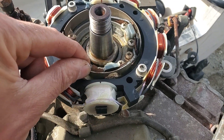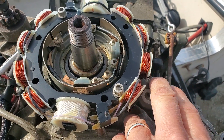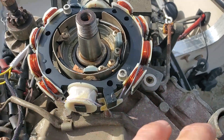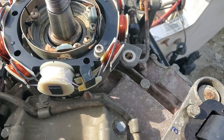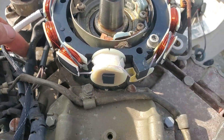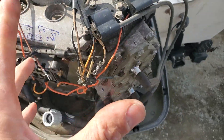The trigger on the inside here — if you advance the throttle, can you see how it moves? As you advance the throttle, the timing increases, just like a distributor with weights, except this is mechanical — it's connected to the throttle. So trigger wires move every time you accelerate. They do get a little worn out, but they produce low volts, maybe four or eight volts. They just send out tiny little signals.